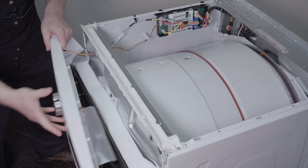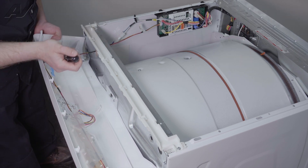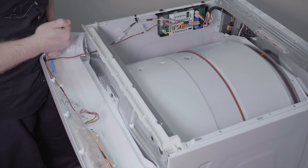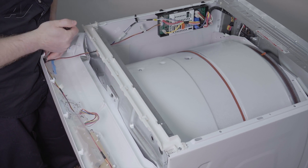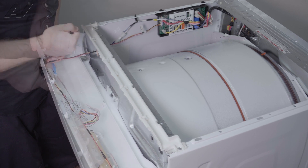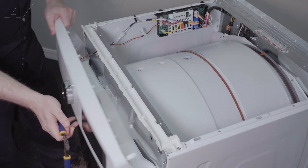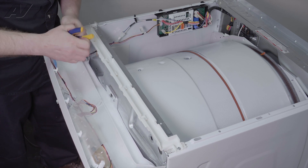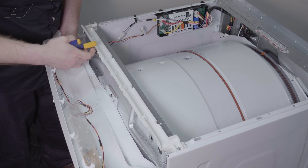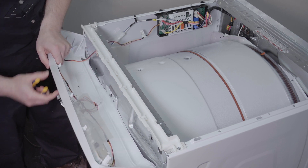Now give us a little bit more slack. The wiring goes all the way back to the console, so what we'll do first is remove the strain reliever just to give us a little bit more room. I'm going to use the tack puller, lift up on the edge and start to take it out. But be careful, as they mount it in very durable plastic, so go slow with it. Because of the way that this is flexing, I don't want the plastic to break off, so I'm just going to cut the strain reliever off. I'll push that remaining through, and then when I reattach it, I'll attach it with a zip tie onto the same spot.